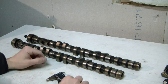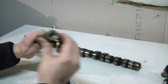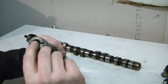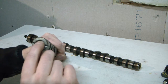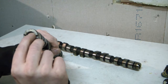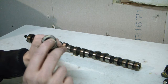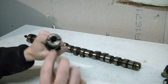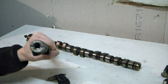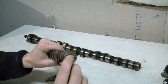So let's go ahead and start with identifying your cam. On the cam face up here you will see the Volvo part number, and then after that there will be a P, then another letter, and then the last letter E for exhaust or I for intake. This one actually says PGE, so this is the G.